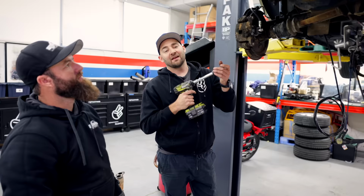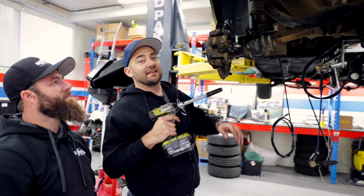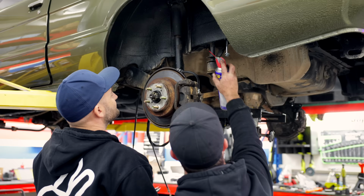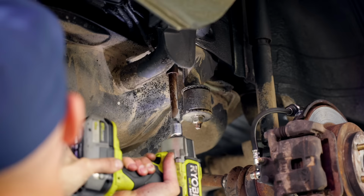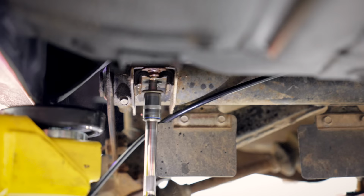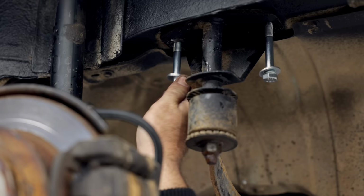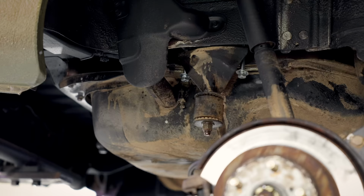We're actually going to do the rear lift kit first. That's the body lift. So the way that works is we unbolt a bunch of these brackets, those brackets, brackets there, and then we put the spacers in that Dave's made. So we're going to whiz them off and install the whole thing. All the original bolts have been in there for over 30 years, so a bit of WD-40 helps loosen things up. The kit comes with all new bolts, and when you're doing a lift, it's important to check the grade of the bolts to make sure they're equal to or better than what you're taking out.